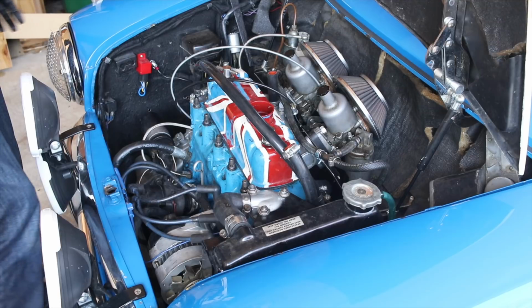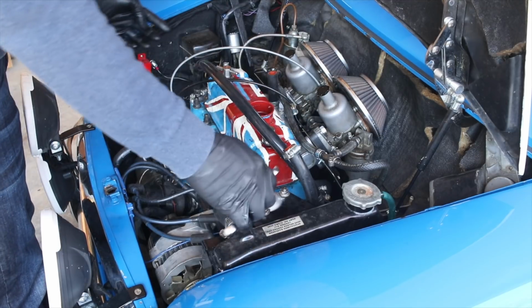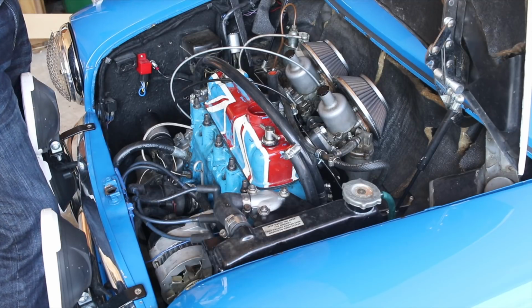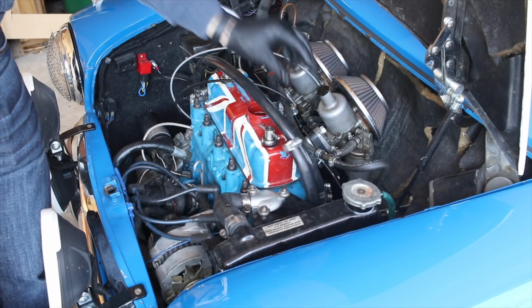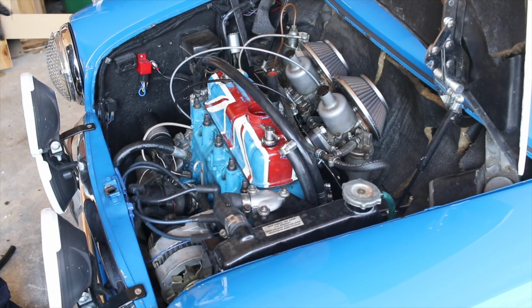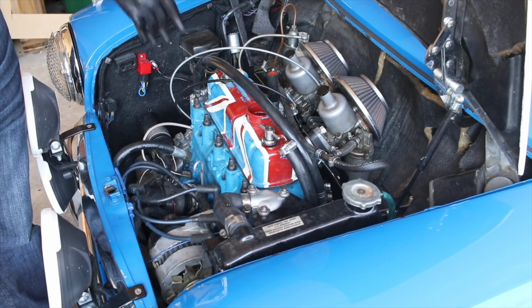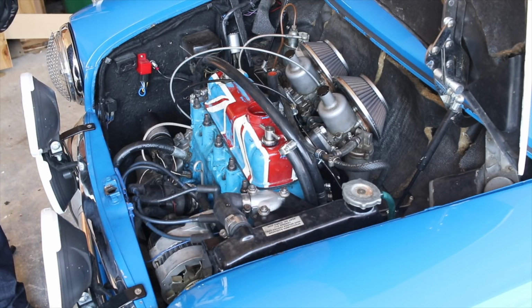Now what I'm doing by reconnecting everything the way it was before, I'm setting up this PCV valve so that it is a closed system again. Previously I was running the exhaust gas into my valve cover and then out of the valve cover and into the PCV valve. And I'm wondering if there's some moisture getting introduced somewhere in that system. If it's open to the air outside, it's going to introduce some moisture. So I'm hoping to reconnect everything here, and then we'll see how it goes. If it's being sucked into the intake, I'm not too worried about moisture getting in there, because then it's just sucked into the pistons and exploded again, which burns off that moisture. But if it's in the oil, then it's mixing with the oil and reducing the oil's viscosity, and that can cause engine failures. So definitely do not want that.